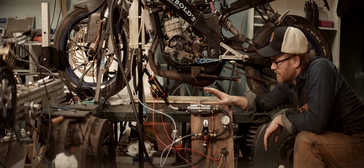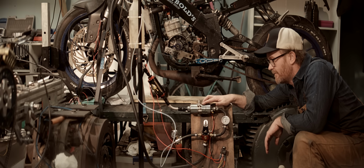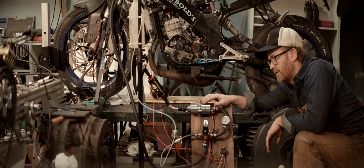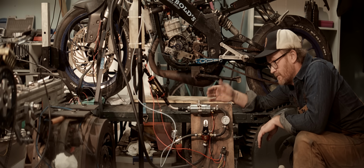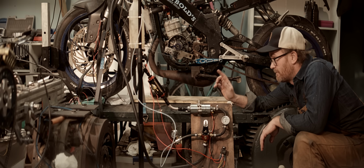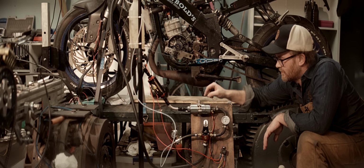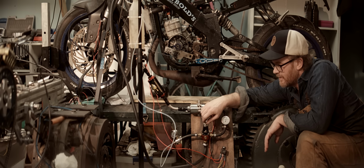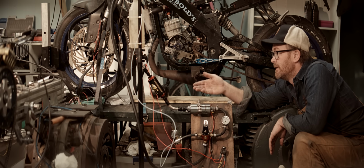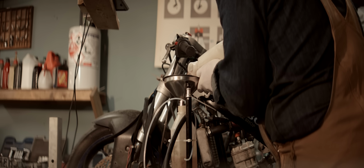So now our setup is a normal EFI pump, which says it's okay with ethanol fuel, so E85. And says it's specifically not okay with methanol, though I have been running methanol through it for testing, and it seems to work and it has survived. Now it will have its go with pure nitromethane and a little bit of oil. So this is a normal return type fuel system, so this will be going full song all the time. And the check valve in our nozzle is 1 bar, so we'll have to set this higher than 1 bar, and hopefully fuel flow is not too high for our first test here.